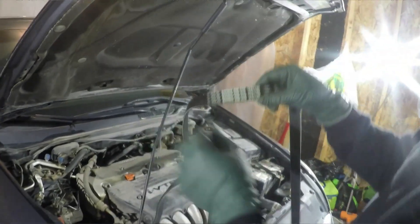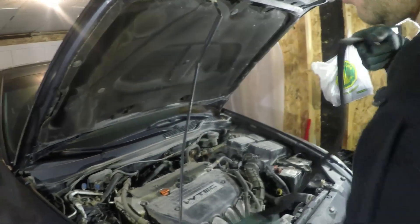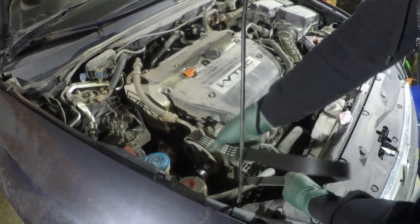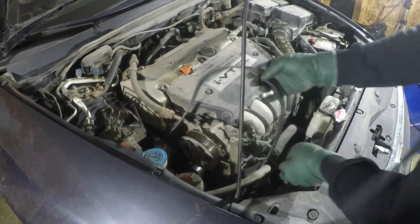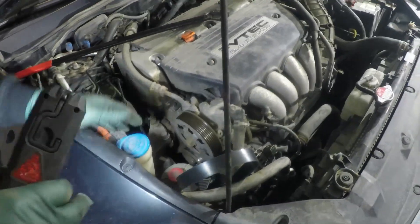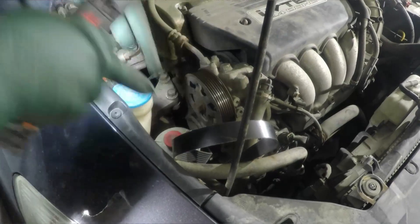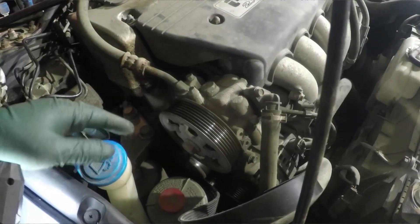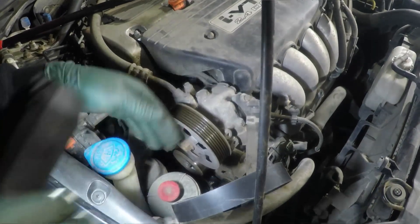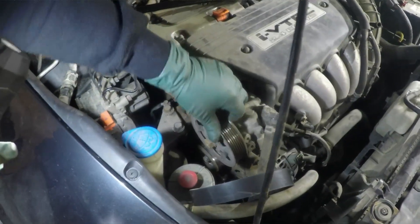When installing, make sure to put the letters on the outside of the car. Don't forget that diagram — draw it or download it before you start because it can be painful otherwise. It is wise to start from the bottom and work your way up, because that makes it easier to work in the tight areas. We didn't remove anything here, so we just work with the space given, which is why starting at the bottom and working up is better. Leave either the power steering pulley or the tensioner pulley for last.